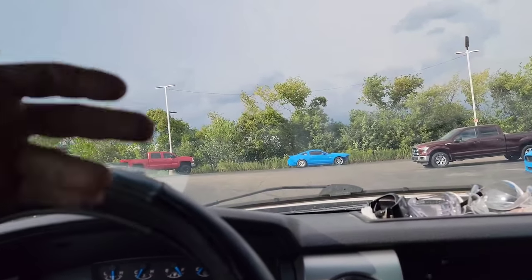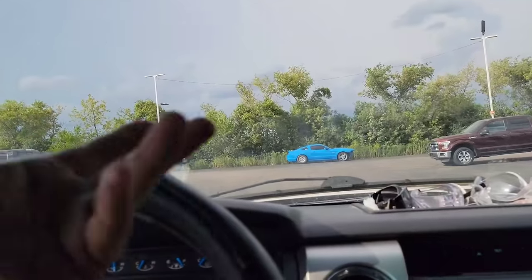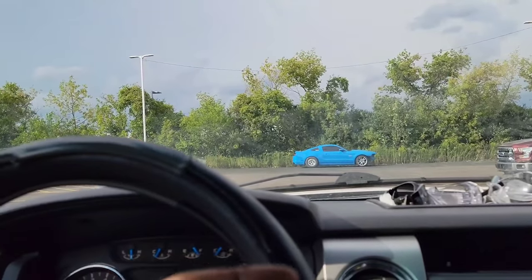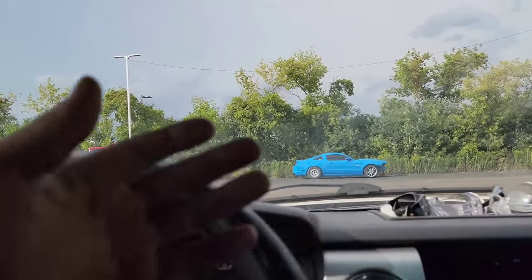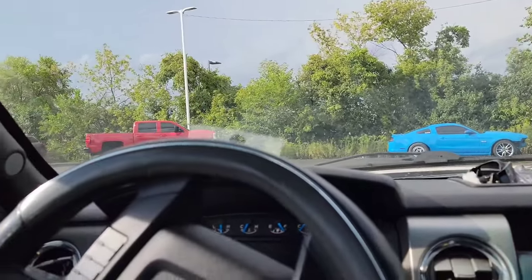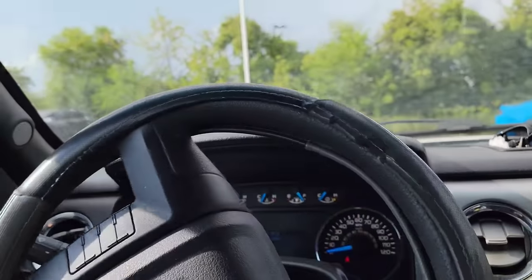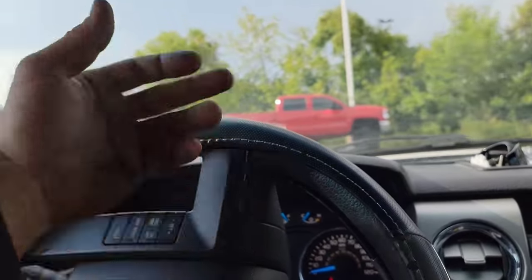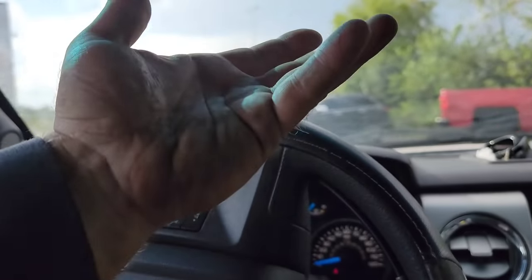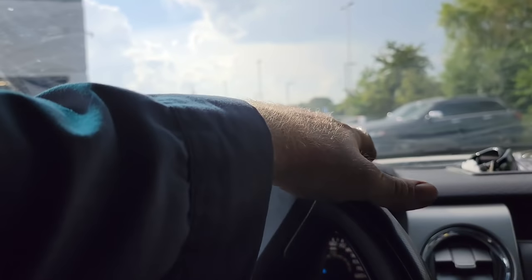Once you crank so long and it clears everything out, it'll start up and run fine. But then when you shut it off and let it sit for a long time and all those vapors fill up the intake manifold again, all of a sudden it's another hard start. Elongated crank. It's a typical issue with purge valves, especially after you fuel up at the pump and fill up the tank, which raises the fuel level and pushes all the raw vapors up into the intake manifold.